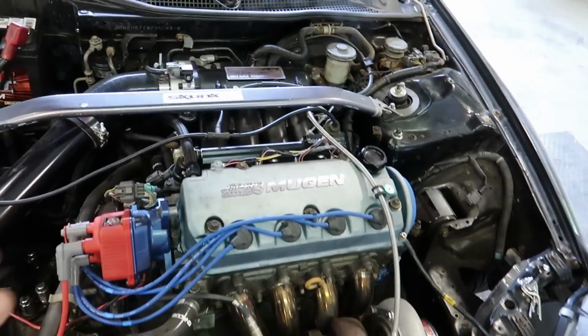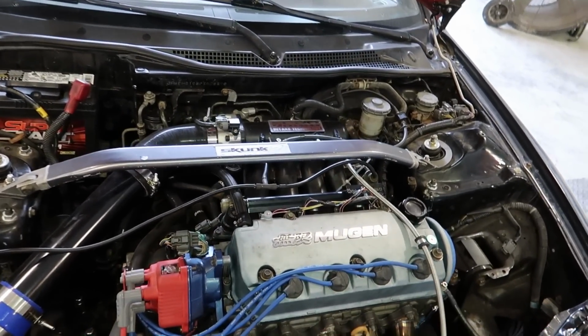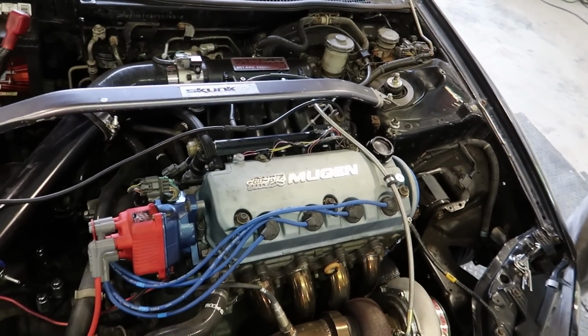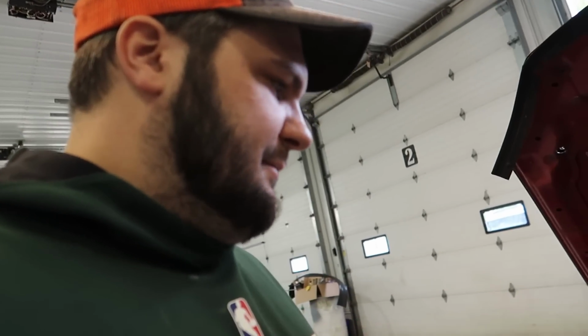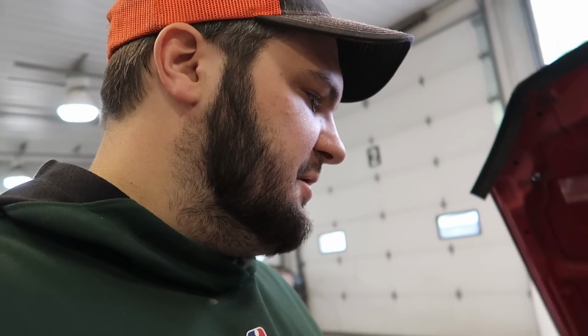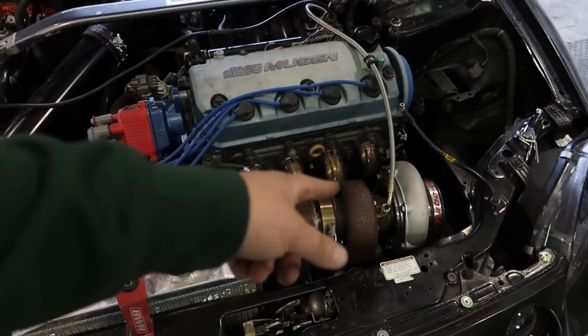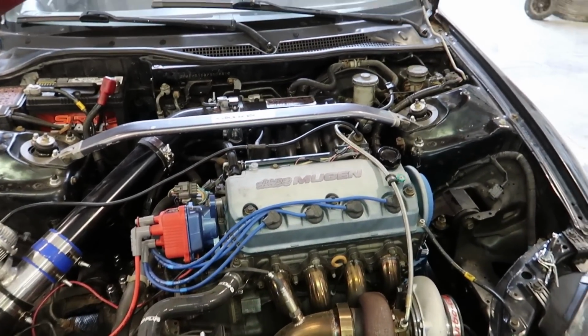We're definitely going to be limited by the fuel system here with the normal style deka injectors. These are really only like a 700-ish cc normal style truck injector. So hopefully we can make over 300 horsepower and get this thing ripping. He did warn me he was going to switch to the Hunter Tune 1500s, but unfortunately it does have a stock-ish clutch in it. So we're going to see where it goes with these injectors, and we'll get a good idea of the power curve with this ginormous turbo on this little motor.